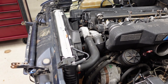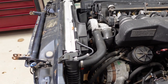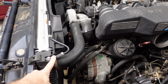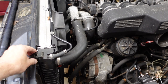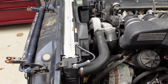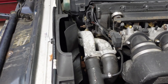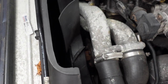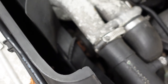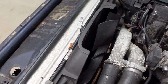Progressing to removing the front end of the vehicle, we're going to start attacking it from the engine side. We have to undo this radiator hose right here, and this overflow hose. We have these clips that I always seem to murder every time I touch them, but I think I figured out the trick to using some diplomacy to coerce those off cleanly. We have to get the viscous fan out — it's actually a reverse thread. You counter hold the pulley and smack it loose with a special slim wrench. I'll show you.